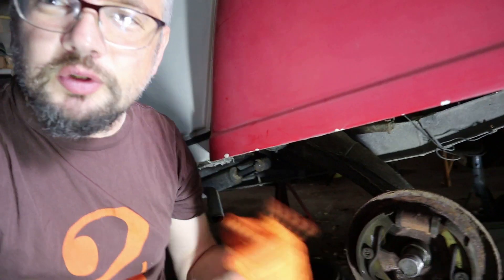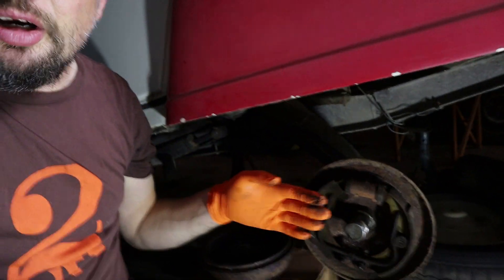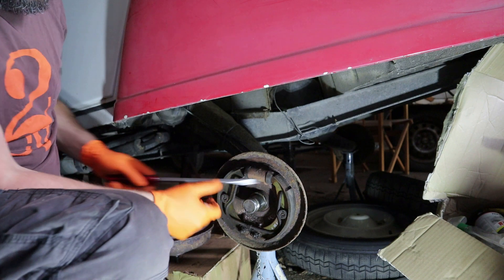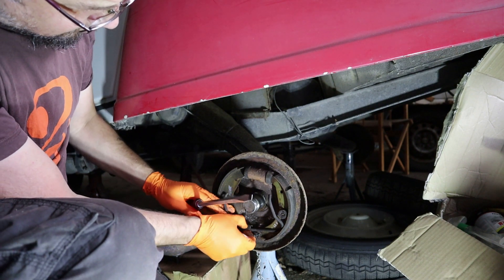I don't have to be too careful, but I will just give an asbestos warning. These are definitely asbestos-free brake shoes. Obviously if you're working on older cars you need to be very careful about what braking material was used - I'd be a bit more dubious working on the Fox; I suspect the linings in there could well contain asbestos. So let's see if we can get this big spring out of the way. A decent levering screwdriver would be particularly useful just now. This feels entirely like it could explode into my face. There we go - that's the release spring out.